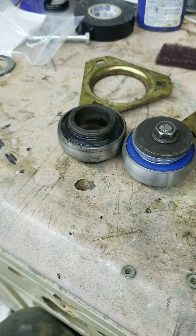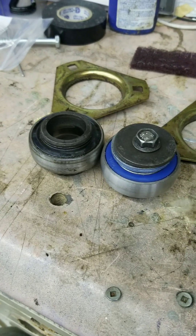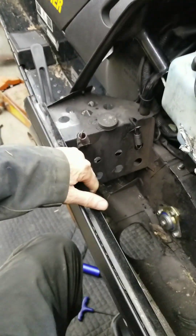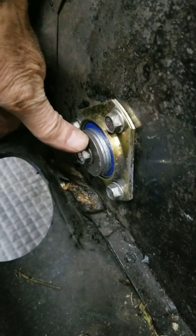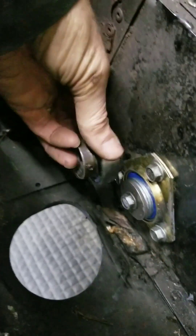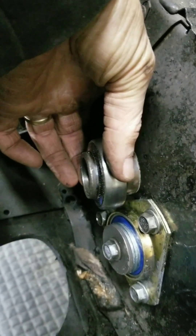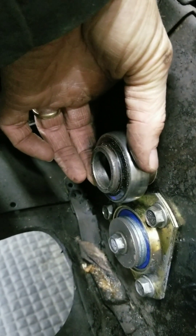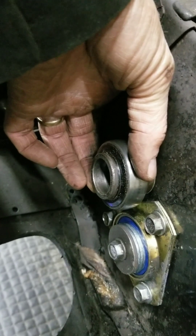Any Skidoo wide track uses this bearing up to 2007 and they're no longer available, so I'm sure I'm not the only one chasing this. Here we have the bearing in place, bolted back into the snow machine — you can see the sled. That's the SB205-16, bolt and washer on the end of it, and the washers to make up the space of the collar. Here's the old one — the new one didn't have that collar on the outside, so the washers are making up the difference. Everything seems to be okay; we'll give it a try but I'm pretty confident it's going to be good.